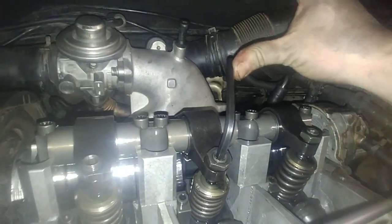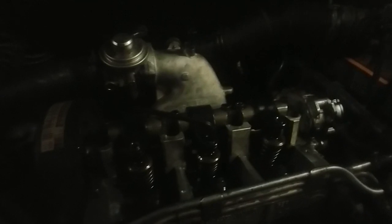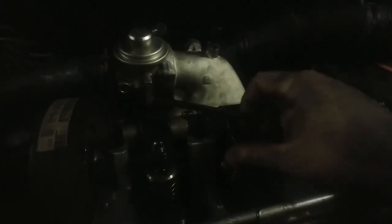Some cars require 90, 180, or 225 degrees. When you're setting the 225, do use a dial gauge or some kind of angular mechanism. The long and short of it: rotate the engine clockwise until this lobe here is at maximum lift and this one gets maximum depression. Rotate lightly until full lock. Rotate back 180 degrees. Torque down to 30 Newton meters. That's the long and short of it. I hope this video helps.